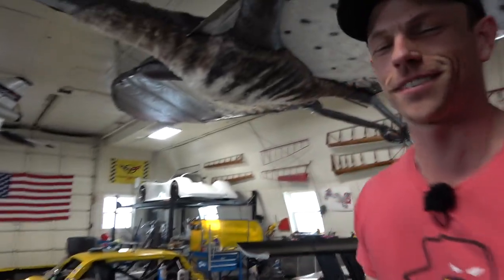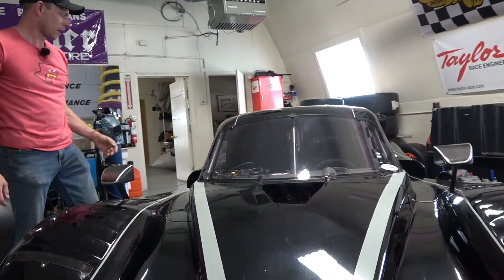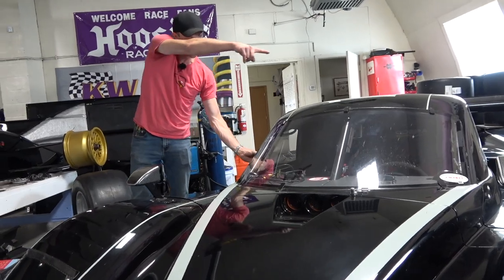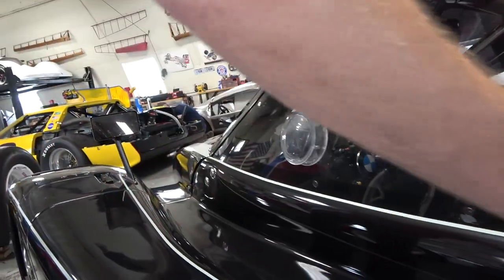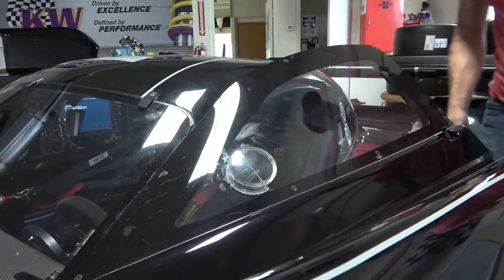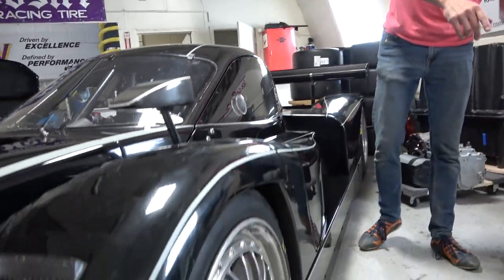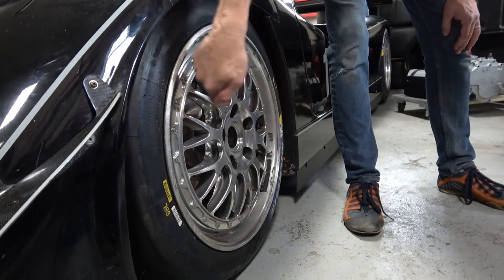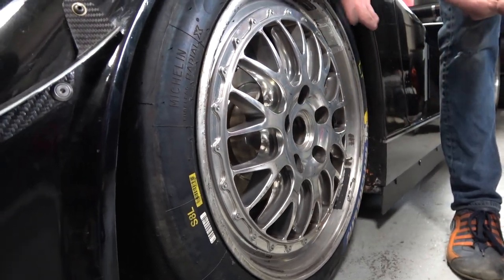Let's look at the front of the car. You've got your scoop here — we've got three inlets right here for the cockpit. On the side windows on both sides there's a little round polycarbonate vent, which is typical for aviation. This vent is something the driver can pop out and it can be a scoop, or you can turn it around and pop it out to let air out. Also, because this was a track day car, these are in fact three-piece BBS wheels, milled with a ball mill on the inside to make them really light, but with a five-bolt hole pattern typical for a street car.